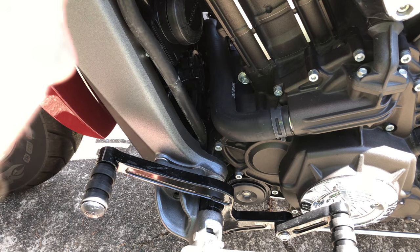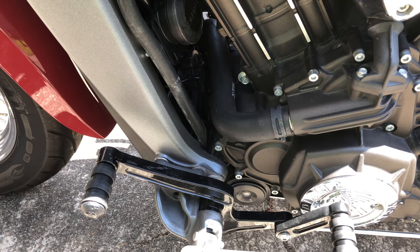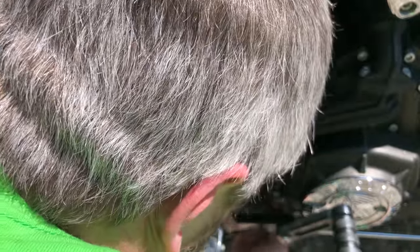The new horn came with a relay. We're going to get the wires off the old horn and run them up to the relay. The relay will use the low current from the original horn trigger to trigger the relay, and the relay will supply power from the battery straight to the new horn. This horn has come off every time I change the oil — kind of an annoying place for it. Almost 20,000 miles on the bike.